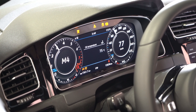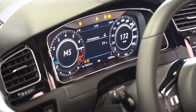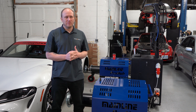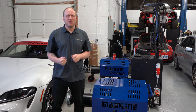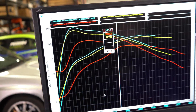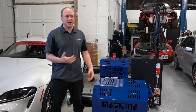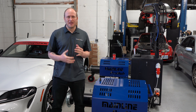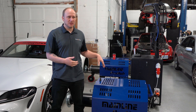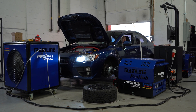We've been offering dyno tuning services for a long time, but this will allow us to have more control over the process. Most vehicles on the road today can be tuned without you knowing anything has changed outside of better performance, and this equipment allows us to show you before and after results. The consistency back-to-back is unmatched compared to a roller dyno — how loose or tight you strap a car down can change the horsepower reading, and going from a 45 to a 30 sidewall tire also changes the reading. With a hub dyno, you eliminate all of those variances; you could load this car on the dyno, take it off, put it back on, and the numbers will be within less than one percent.